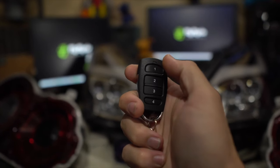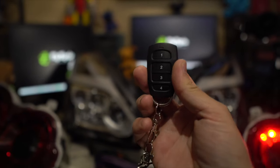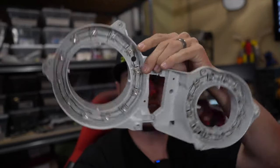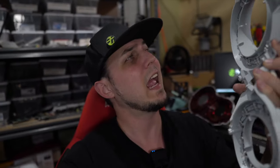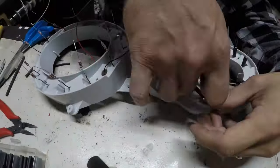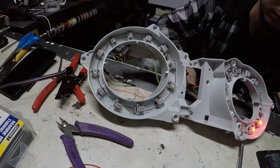I use the controller a lot in my videos because I just want to be able to turn things on and show different examples of cool stuff that has been built. The controller plays a huge role on the actual car. Using these factory GTR taillights as an example, the LEDs are very straightforward — they have power and ground going to each LED. We can take control of them ourselves just by giving them 12 volts plus a resistor hooked up to a ghost controller that drops the voltage exactly where it needs to be for each LED.